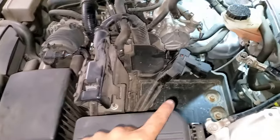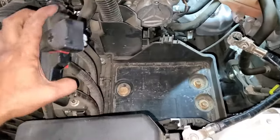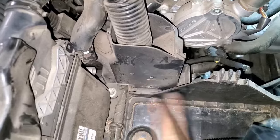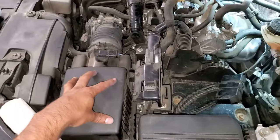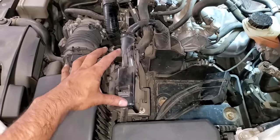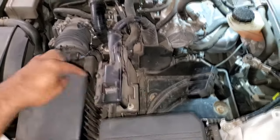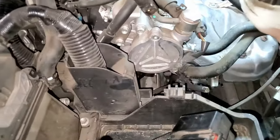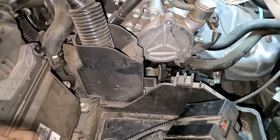Now that we've removed the battery, it is pretty obvious that we're going to have to remove the tray. This portion here is part of the tray, and the air box grommets are on top of this bracket. We're going to have to remove the air box, unhook the PCM and the bolts associated with it, remove them out of the way — that is how we gain access to the housing for the thermostat right behind that plastic container.